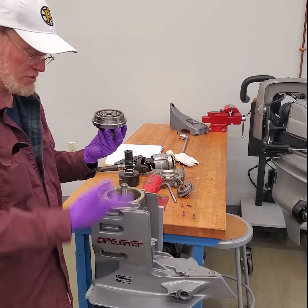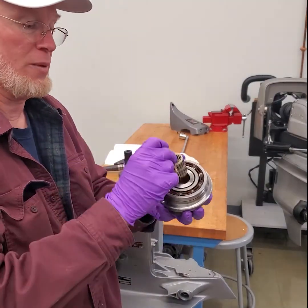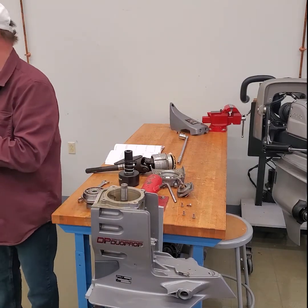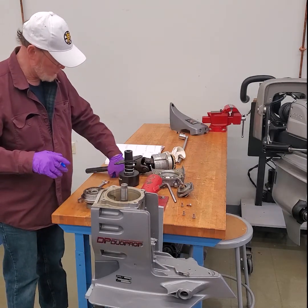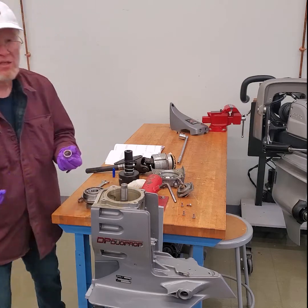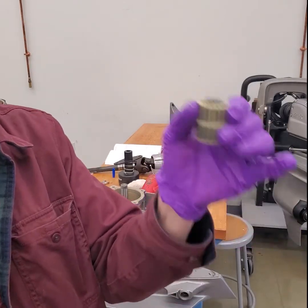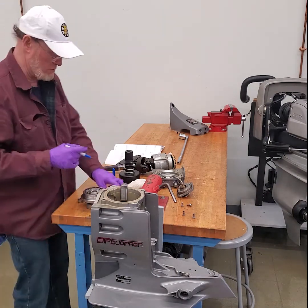You're going to reshim the drive probably unless you're just cleaning it and resealing it. There's another bearing in here and this is a loose cage needle bearing. That loose cage needle bearing should be marked if you're going to reuse it. So what I want to do is get a Sharpie — that bearing has been run in one direction its whole life. What you want to do is put a reference mark on it. I simply remove the bearing and take a Sharpie and mark one end of it. That way I know which end goes up — up is always the mark.